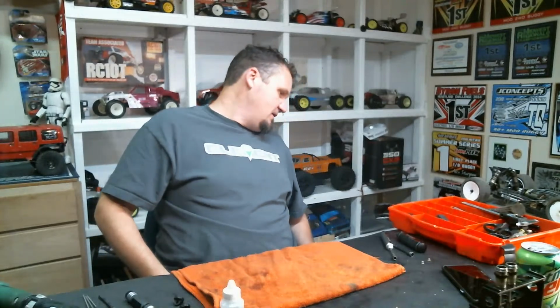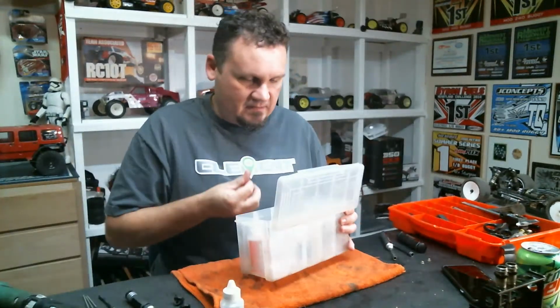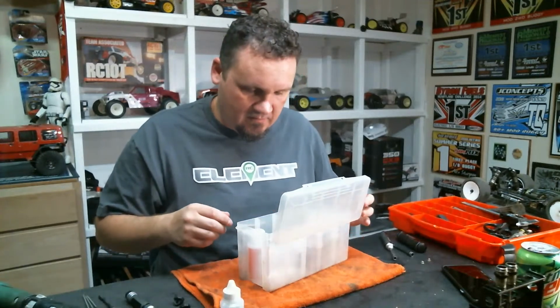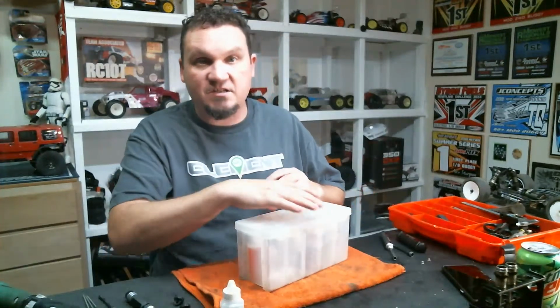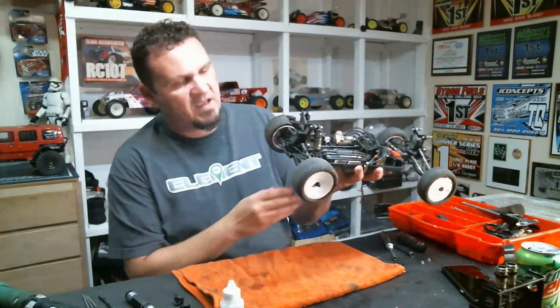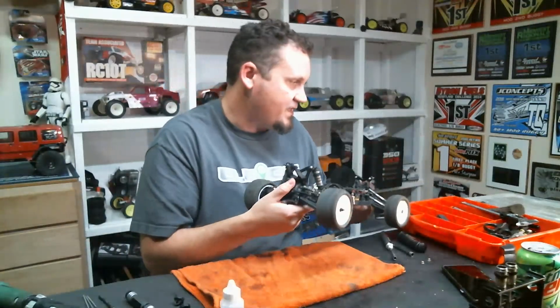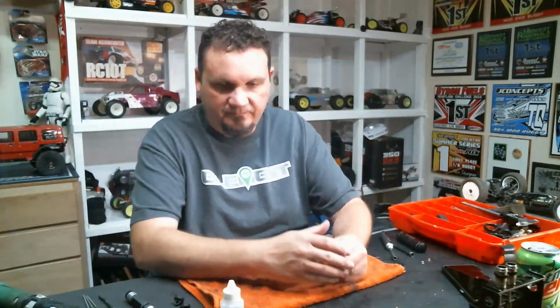Shane wants to know, do I run the box stock setup? Sort of. My car is kind of a mishmash between stock and Tom Rennerneck stuff that he posted online. And I also changed the pills in the back to match my two-wheel drive car, because my two-wheel drive car with the pill setup I have now was really good. So I'm like, well, I'm going to put that on my four-wheel drive. I have 5-up in the back, and to be honest with you, I haven't looked at what all the other setups have for that, but it did work pretty good. So I'm okay with that.